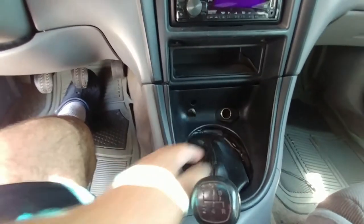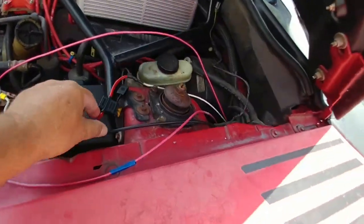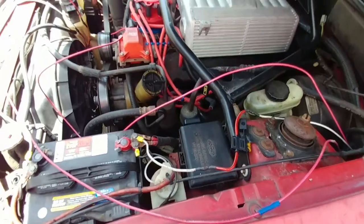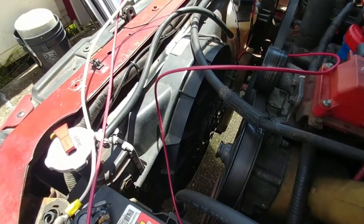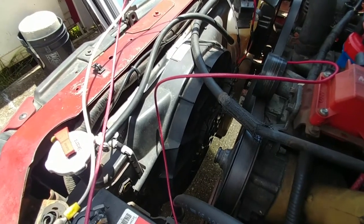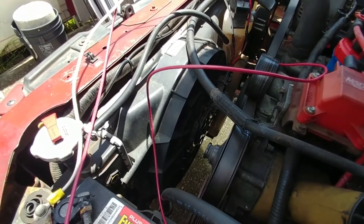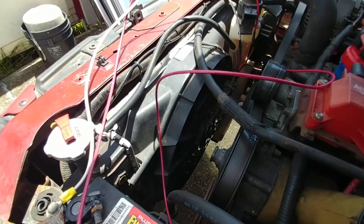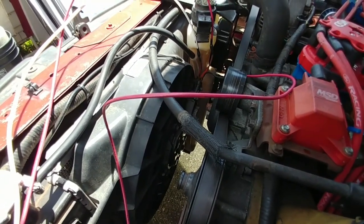Just to show you, it works real good. The low side — put it on. The white wire is back there. You can see the 20-amp works fine. This is the power wire — it's got the 20-amp fuse in it. That's a 20-amp switch, by the way. And you can see the fan is running. We'll work on the high side in a little while. But this car only ran up halfway even with no fan running, so this car should run real cool once everything's done. We controlled the fan controller, and I didn't like the way that was going — it worked at first, but then it just quit working. Any questions, leave them in the comments section. We'll get back to you on that, and I hope that was a detailed enough account that you guys can take care of that yourself. Thank you.